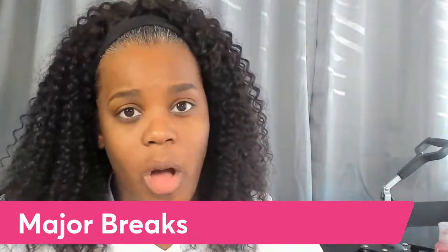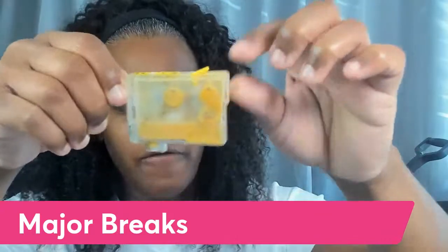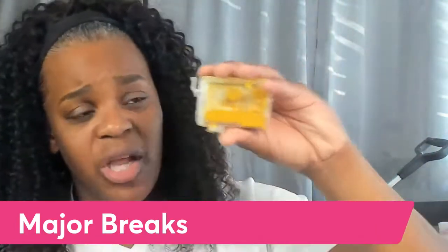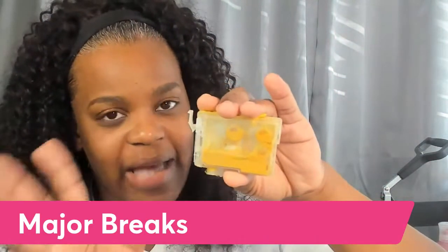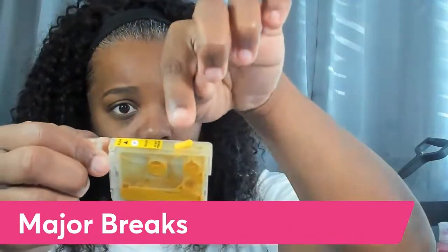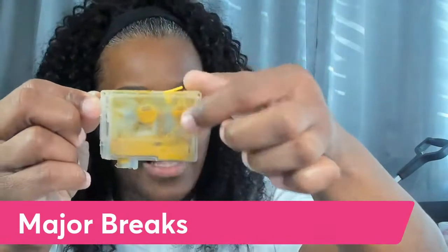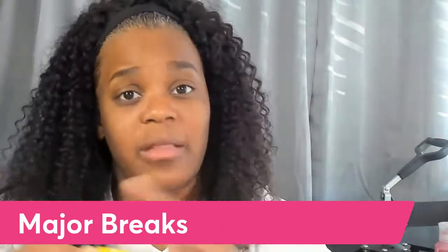The other thing that will cause that is you have your plug in your vent hole. Your vent hole is always to the back, no matter what your cartridge looks like. Even if you have the one that's not like this, this is the best cartridge. It regulates. My ink never really goes past this point. Once it tells me it's out of ink or close to being out of ink, it's at this point right here. But with any cartridge, whether the fill hole is here, here, or here, the back one is always your vent hole. You don't have to worry about it if you get air in there, or ink in there, or if there's no ink in there.